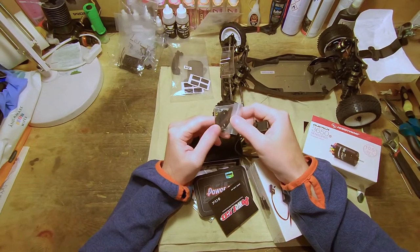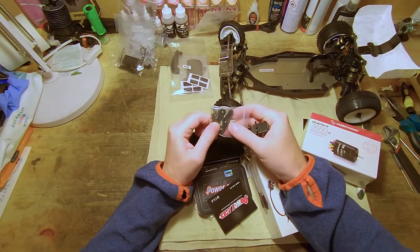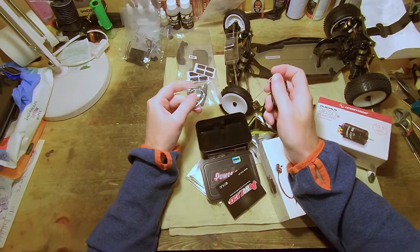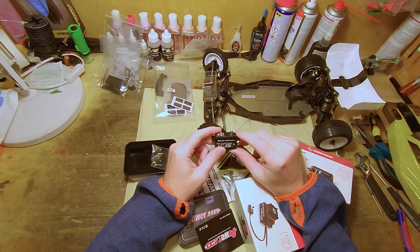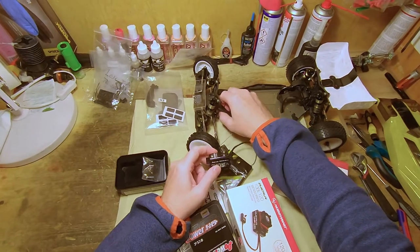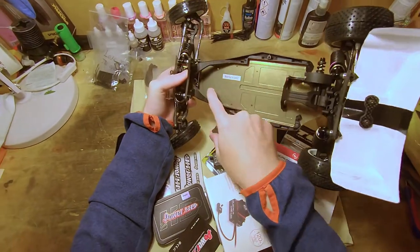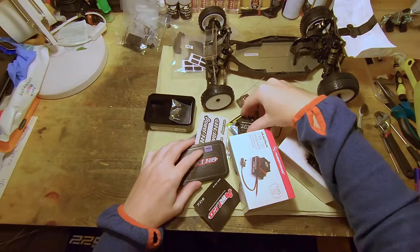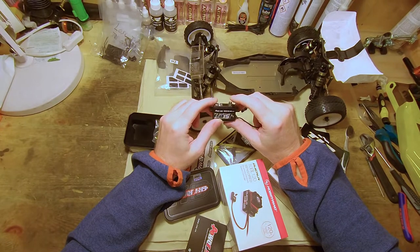And you see, you get the servo with some servo horns, but they are plastic. And you should really have steel or aluminium servo horns, because you don't have a servo saver with these 1/10 scale cars. You just mount the servo horn and it goes directly into the servo link here on the car, as you can see here. So you don't have a servo saver, so you should buy some quality servos with steel or titanium gears.